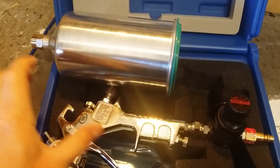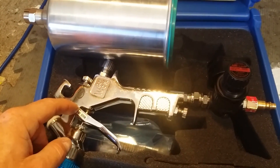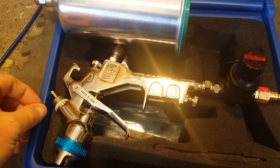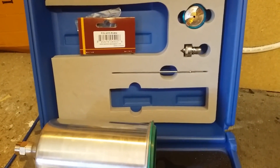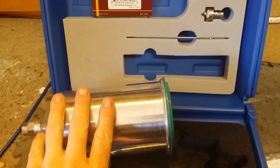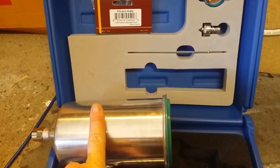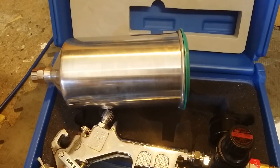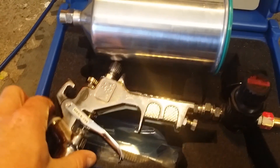I have used this gun several times and it sprays really, really well. I love the atomization on it. It is a 29 psi / 2-bar gun, which is where my regulators are already set up for my SATAs. The kit comes with a 600 cc cup. I do have a 250 or 300 cc cup with an adapter, because I paint a lot of small pieces — no point using a 600 cc cup when I'm only using three to six ounces of material. It takes adapter number 28 for the smaller cup.